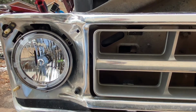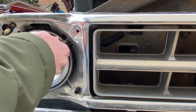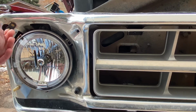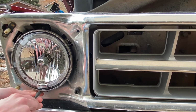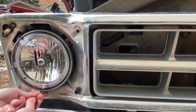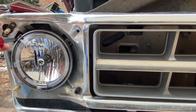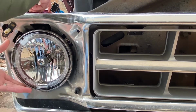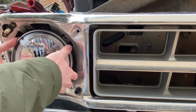Yeah, so looking back at yesterday's footage, I realized that maybe some closer shots could be worthwhile here. So there's this retainer ring, just 3 screws, for when you're taking these headlights in and out off bump sides. 1, 2, and then there's a third one down here. See if I can find it without bending over. Or yeah, there you are. 1, 2, 3. Don't have to take them all the way out. Just loosen them a touch. So slide this retainer ring over to the larger holes there. May have to loosen this bottom one a little more actually. Yeah. Yep, so that slides over like that.